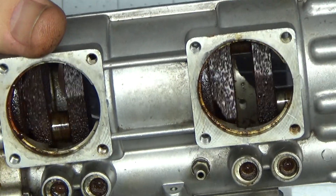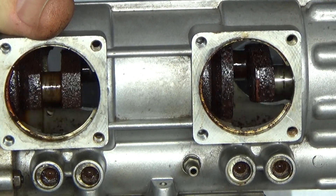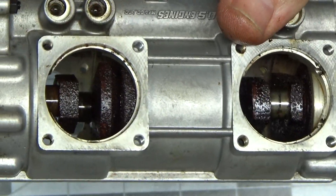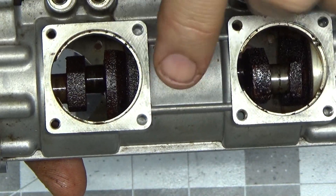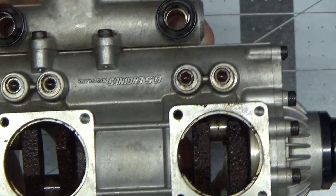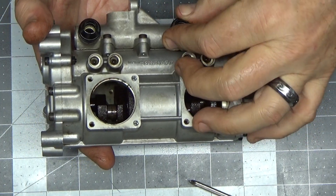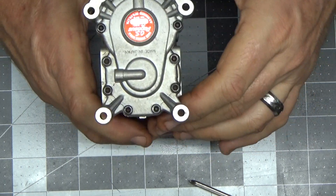I don't know if you can really see how bad this crankshaft looks. Now the thing that many of you may not know is that this is actually a two-piece crankshaft, which is going to make it extremely interesting. It's split here in the middle and it's just got a steel collar as a joiner. Getting this crankshaft out is going to be interesting, but I'll go to this rear cover next.